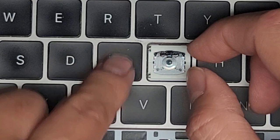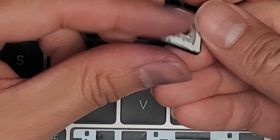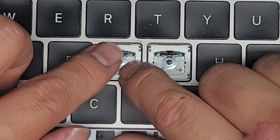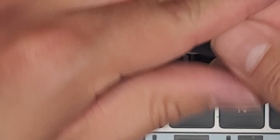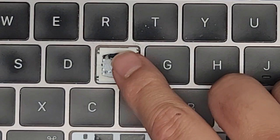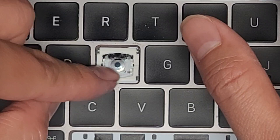Let's get this piece back out one more time just to show you guys — people keep saying I'm teaching people how to destroy their keyboards. But it's this versus going somewhere and having your entire keyboard replaced for several hundred dollars. You can get these keys for under $20, so $20 versus hundreds of dollars. You do get a new keyboard, battery, and trackpad if they replace the entire palm rest assembly, but if all that's wrong is the key popping out... Also, one important thing: make sure that even when you press here, your key actually works — because if the circuit underneath is damaged, replacing the hinge won't solve the problem. Damage is usually all over the place somewhere else, not right underneath the button.